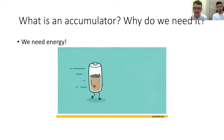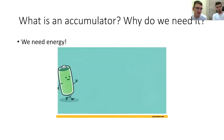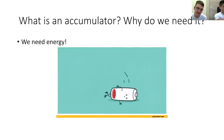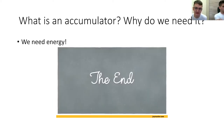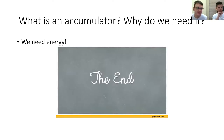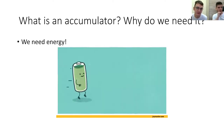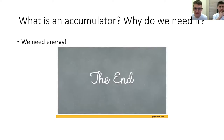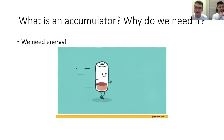What is an accumulator and why do we need it? First of all, it stores energy, but it has a disadvantage against petrol because it's less energy dense than petrol or diesel. But we cannot use petrol for an electric car, so that's why we need a high voltage battery. In Formula Student we use high voltage — a couple of hundred volts DC — and it's a dangerous thing, so first we will talk about safety.